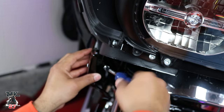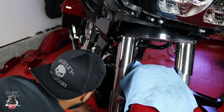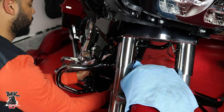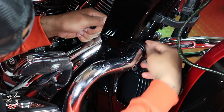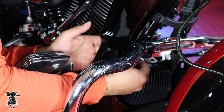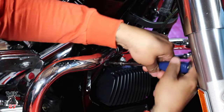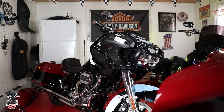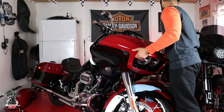Take your second screw and drive it through the bottom where the clip was — nice and easy. Remember you're repeating all these steps on both sides. The hardware also includes two clamps, one for each side, which hold the side fairing onto the crash bar. Screw those in and you'll notice the side fairing becomes very tight and firm. Now carefully fit the main fairing back over the bike — these parts are delicate, so take your time.